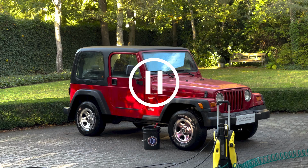You'll notice that our front wheels react much more than the rear ones, turning purple in a rather spectacular way, while there is hardly anything happening at the rear. You might ask yourself why. Well, that's simply because our front wheels have disc brakes while the rear ones have drum brakes.